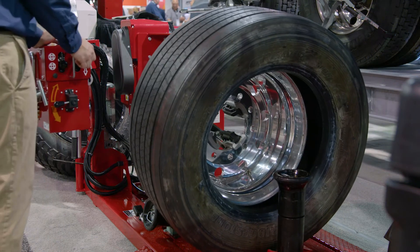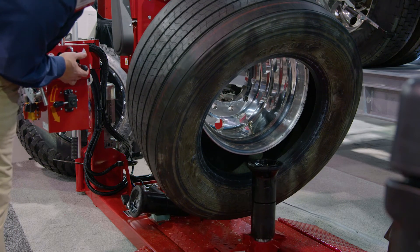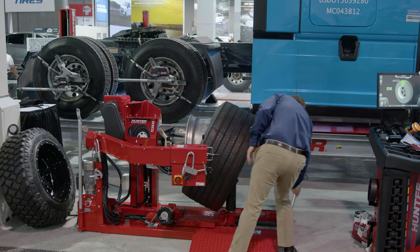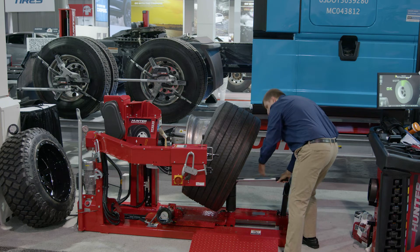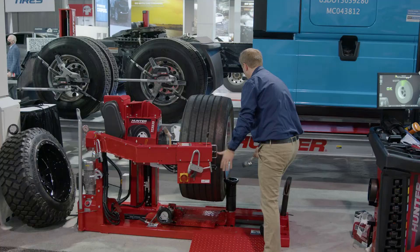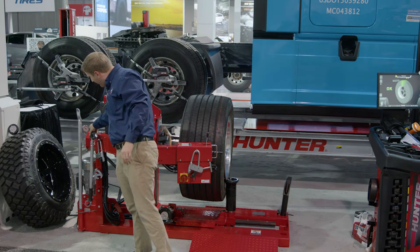And on these wide tires, and even on the standard width tires, I can push on that back bead. My outside bead — I'll bring my roller into position here. I have a quick mount bar that I'm going to use to establish traction with that top bead, or that outside bead. And just like that, I've basically pushed this big heavy super single tire on and off without breaking a sweat.